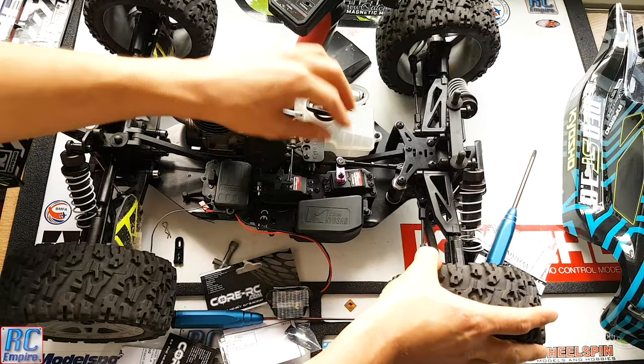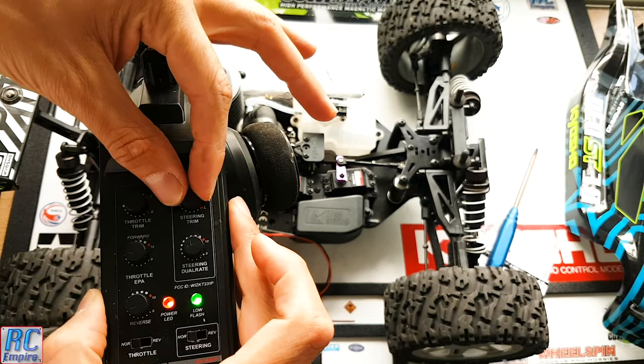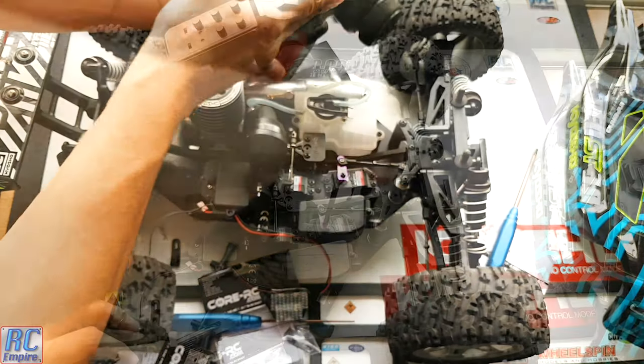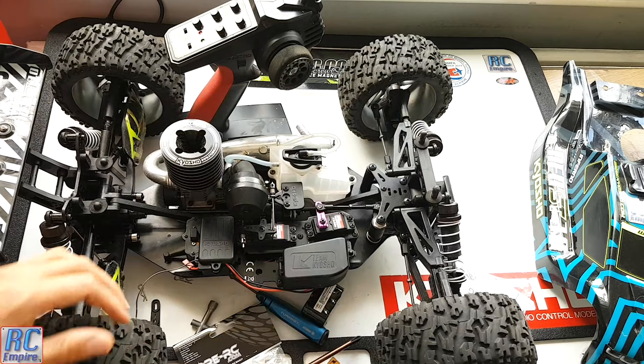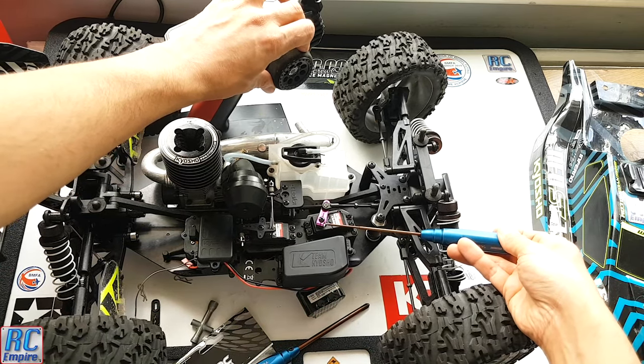But luckily the servos on this are nice and accessible, and you can whip that off and put it back on where the wheels are dead straight when the steering trim on the transmitter is set to zero. But that's pretty much it, nothing too technical, and to be honest, pretty basic. But there is our brand new servo horn, ready to rock on the Kyosho Inferno